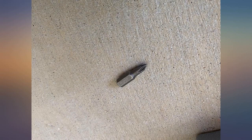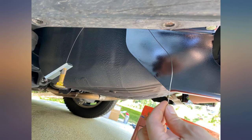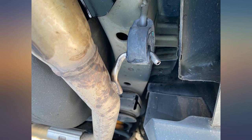Helpful word of advice: the instructions are wrong when it says it requires an 11/16 socket. The mounting bolts that came with my hitch required a 3/4 socket. All in all it was a successful install.